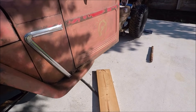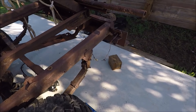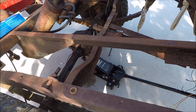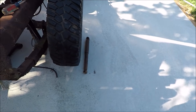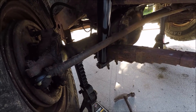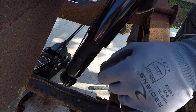All it needs now is brakes all the way around and lights. I've got to change the fluid in the differential, front and rear. I also went through and lubricated every little point - greased them. I've done about 13 to 15 points on it and there are more - they're everywhere, mostly on the steering and in the transfer case and all that.